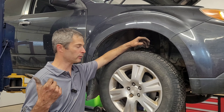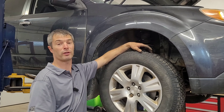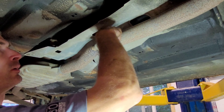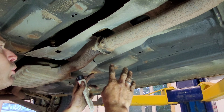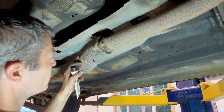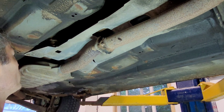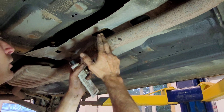Alright, just like that we've installed a wheel bearing and a whole set of brakes on this side. I'm going to do the exact same thing on the opposite side and then we're going to go for a quick test ride to see how it sounds. As you guys saw on the bench, clearly this wheel bearing was the culprit, but I like to change things in pairs — if this wheel bearing is making noise it's got the same mileage as the one on the opposite side. Before I take this off the lift, there are a few more things I want to tackle. We may as well try and deal with this gaping hole in the exhaust here — it's only going to get worse. So as a temporary solution I'm just going to put some muffler cement for now until we can decide what to do, because even if we decide to change the gasket there's not much of a flange holding this together on either side.